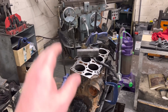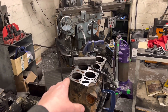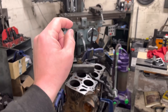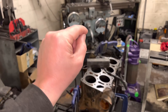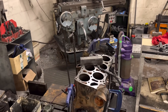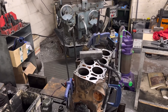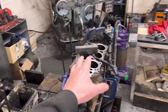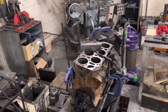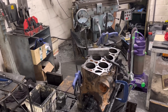So what I'm going to do is bore this to the round figure, and I think we may be going Wossner pistons on this. What I normally do on the Wossners is give it plus half a thou - that'll be perfect for what it is, because this is not a competition engine, it's just a fast road. I normally just give it half a thou over the top, and you're allowed half a thou to a thou anyway.